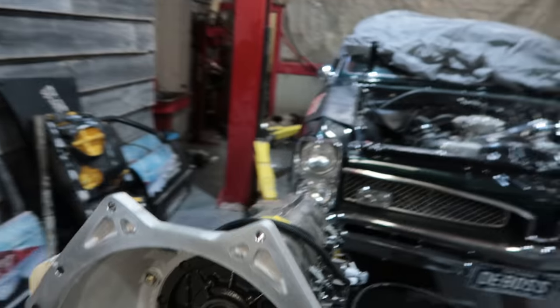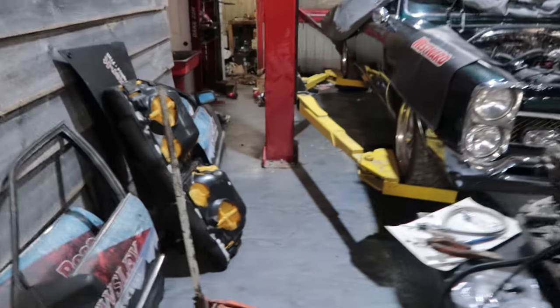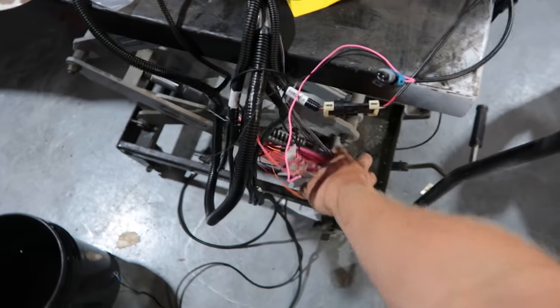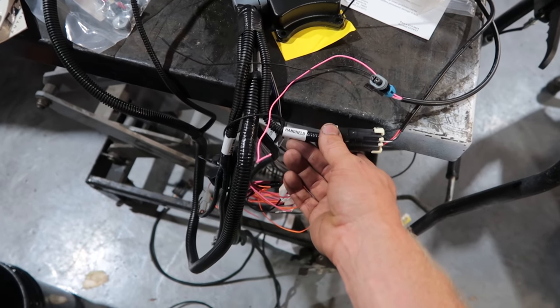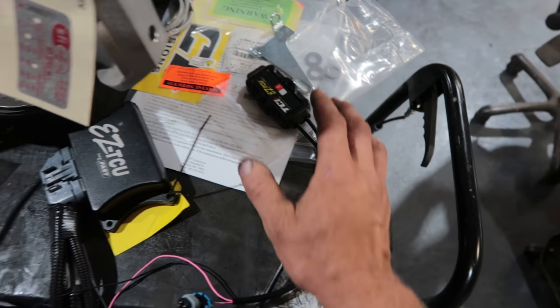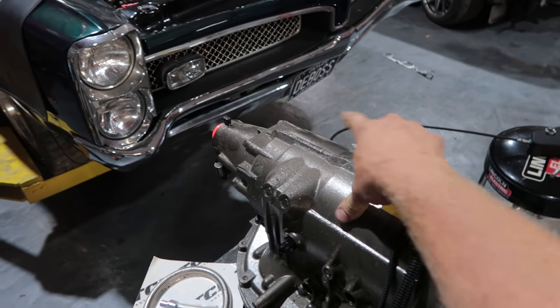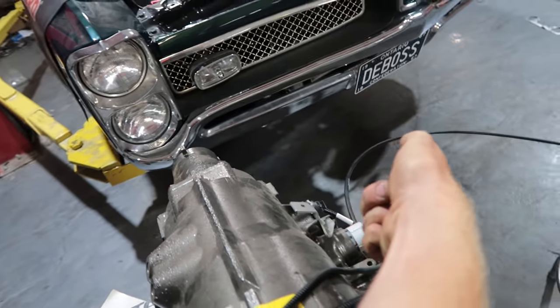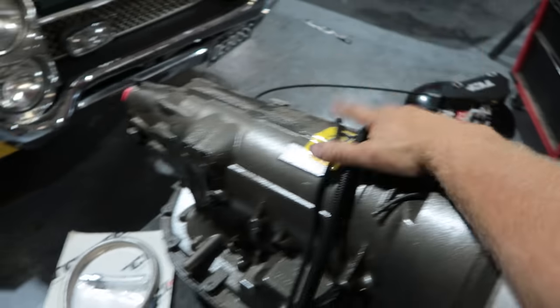We're gonna tie this wiring harness into the harness that we already have to keep everything kind of neat. And it's a very, very simple harness. You've got your key power, black, and battery powers, very straightforward. You've got a handheld plug, and we went with the Bluetooth sender. So instead of a digital pad, since we already have one for the sniper and we want to keep it nice and neat, we went with the Bluetooth. Only two plugs that go on the transmission, your output shaft speed and your plug going into the side there. If you have the 6-speed, then you incorporate the front plug, but that's it for the transmission. And then just a couple plugs on the outside.